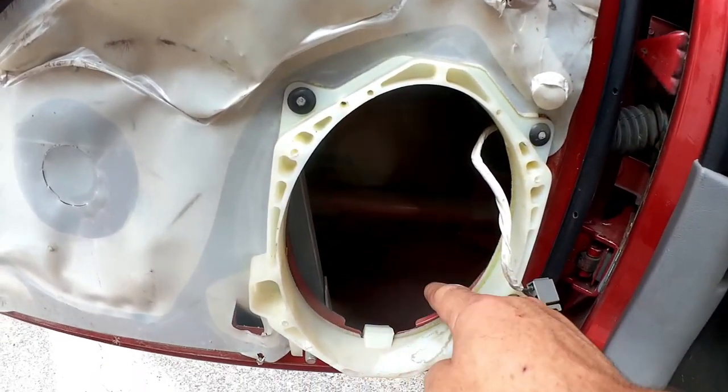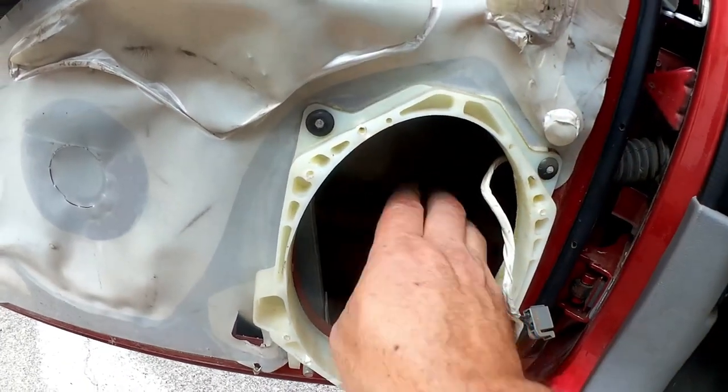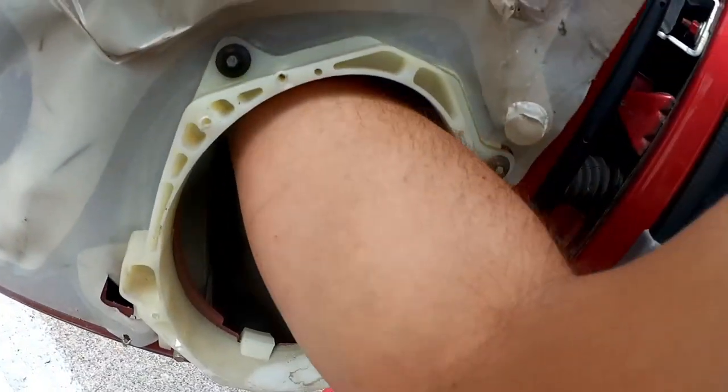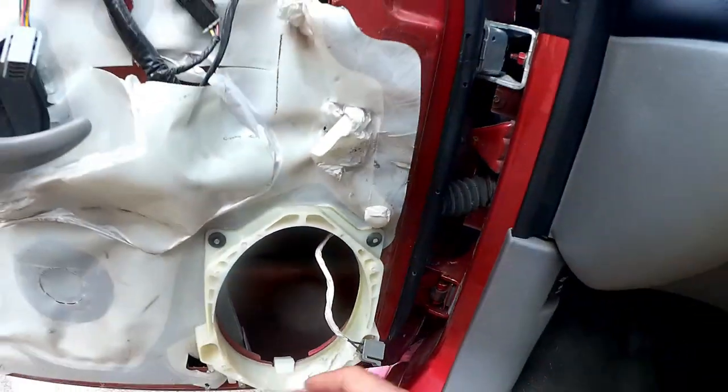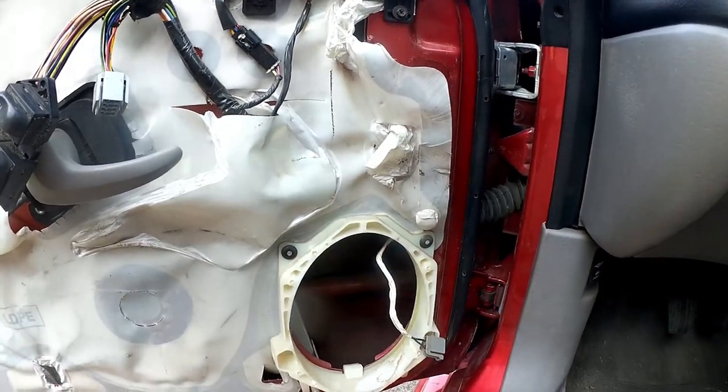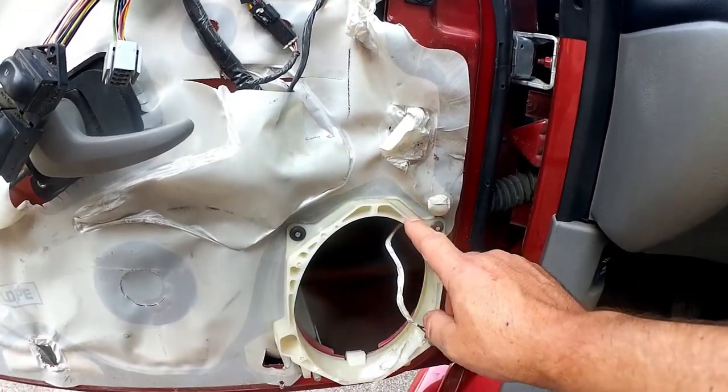And of course, the flat part back there, you can see, well, that's the outer skin of the car. And I can get access to quite a bit of it up here. So I can just reach my arm in and get as much as I can of it, both first with cleaning and second with applying strips of that noise deadener. So we're going to go ahead and put that all in there. I'm also going to apply some around here. Applying some directly around where the speaker is has kind of an enhancing effect. Even though the place where the speaker is physically mounted isn't going to really ring, it's not a panel of metal that has that high resonance, mounting it as close to the speaker as possible does what's called mass loading.